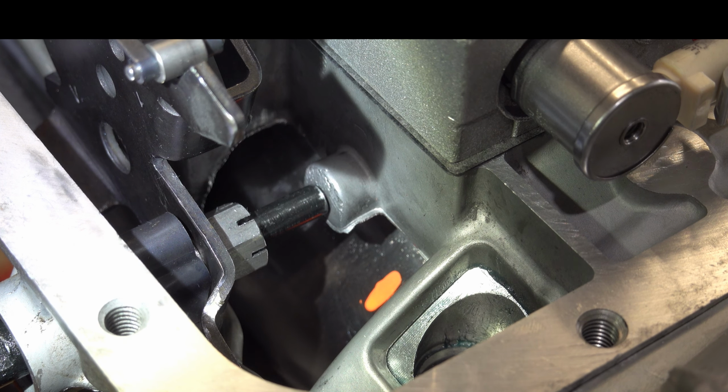All right, assembly's back in, dial indicator set up. No O-rings or sealing rings or anything like that on there, so let's go ahead and do a check. Now zero the indicator first. Okay, looks like it's about 28 thou. We're not quite returning back to zero. Let's try it again. Okay, this time we're at 30 thou, maybe 31 thou.